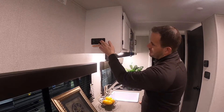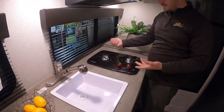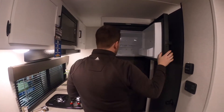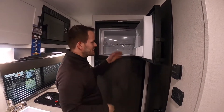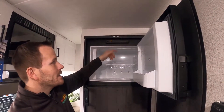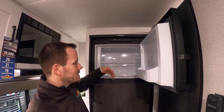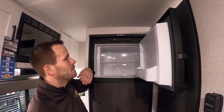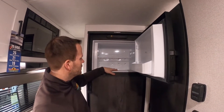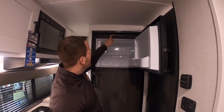You have interior lights and exterior lights. Then you have your awning extend and retract, which is fairly simple. Your cook stove back here is manual ignition — turn it to light and put your lighter to it. Standard microwave up top, and your stove vent fan. The refrigerator is a standard Dometic — it has two buttons: on/off and then auto or gas. I always recommend leaving it in the auto position. That way it'll run off electric if it's available; if not, it'll automatically switch over to gas as long as the LP is on. So if you're plugged in and the power goes out at the park, it'll flip to gas — if you have food in there and you're not around, it would save the food. So always leave it in the auto position unless you really need gas only, which is pretty rare.